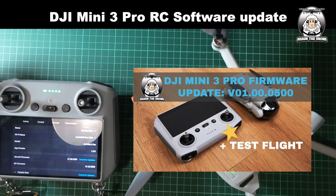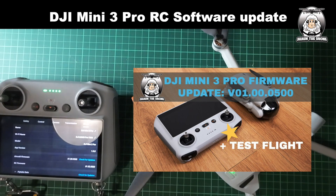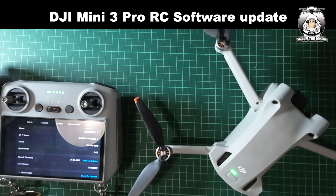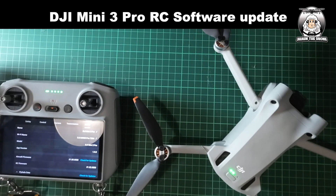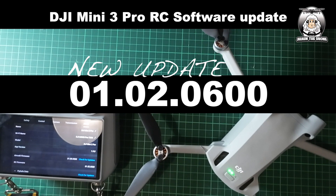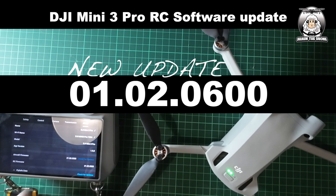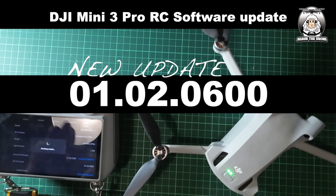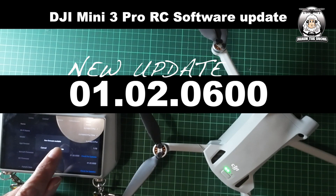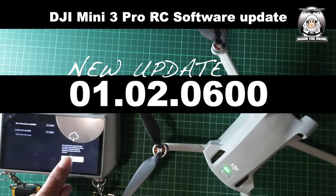The other day I put up a video about the latest update for the DJI Mini 3 Pro, and some people were having difficulty doing that update or it wasn't showing the latest update — that was to do with the speeds. Sounds like DJI made a bit of a mistake and put up another update, so even though we got firmware update 01.00.0500, the app version is only 1.98. As always, just check your updates again, and make sure your controller has an internet connection, or it won't check. So there's the update — it's just fixed some issues — let's do it, it won't take long.